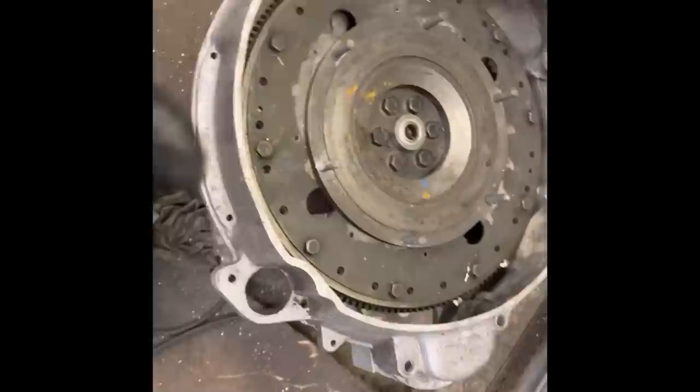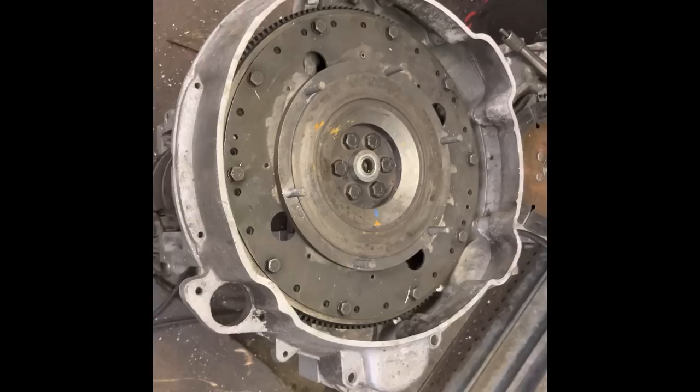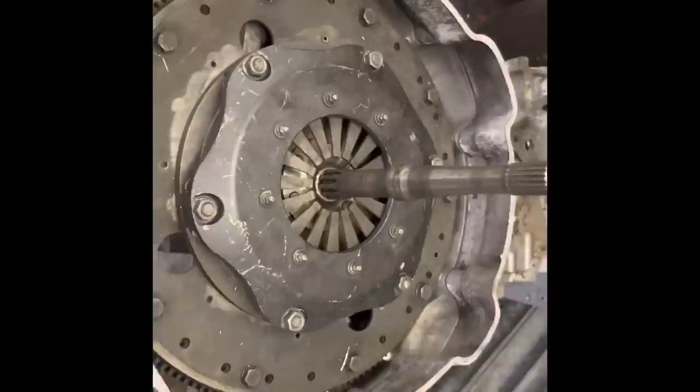What we're going to do is balance the gearbox with the clutch so it's all central, then have a look at the offsets and spacing and decide if it's all going to work before going to the trouble of having the adapter plate made to mount the Hillman gearbox. This is a scrap gearbox that I've basically machined the end off, because I want to get it as close as possible to keep the overall length down on the entire engine and gearbox.